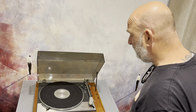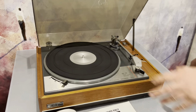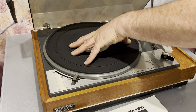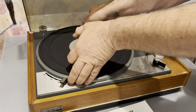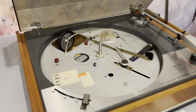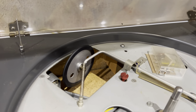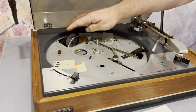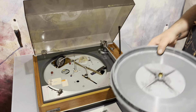Also, when you turn these on after a period of non-use, the platter doesn't get up to speed quickly — it takes a long time to get into motion because it's a very heavy platter driven by an idler. Removing the platter reveals the idler wheel. This unit has a two-hole idler; Lenco collectors prefer the five-hole idler. There's also a plastic version which is normally a bit noisier, but the two-hole one here is fine.